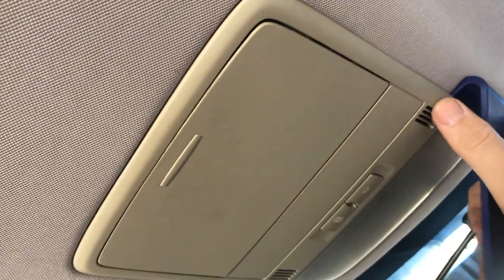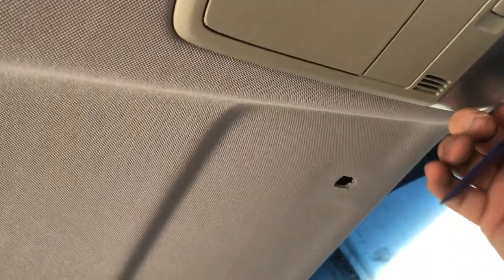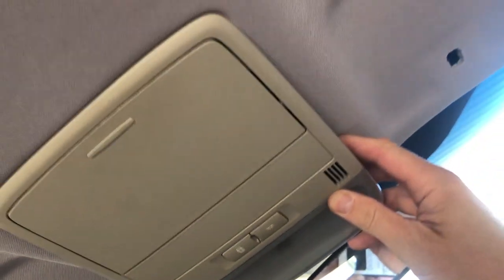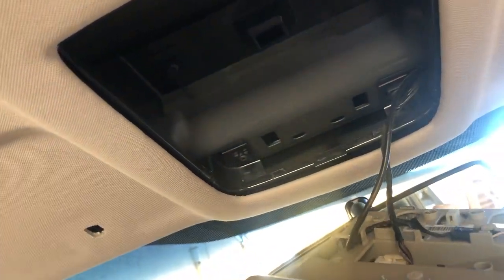The one that we're using in today's video is a nice wide one. You can use your fingertips, but it's so much better just using this tool. Pop down the front section — they can be quite tight depending on the bracket behind it and the little metal tabs. Pull it away from the rear section and those two tongues basically tuck underneath the headlining and the bracket itself.